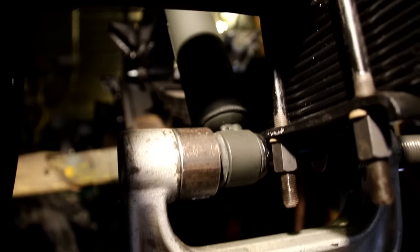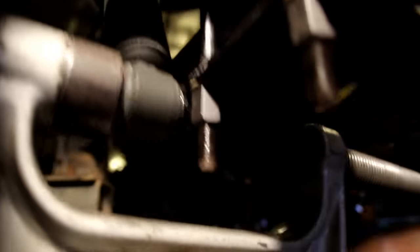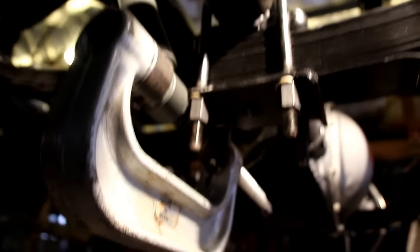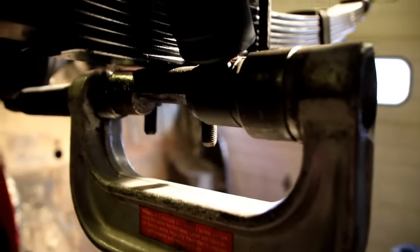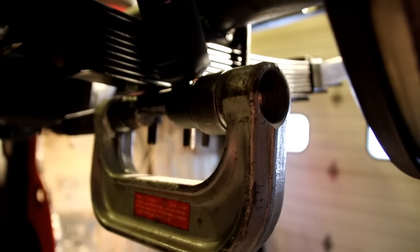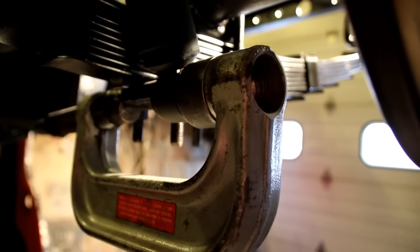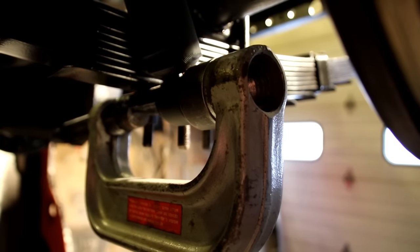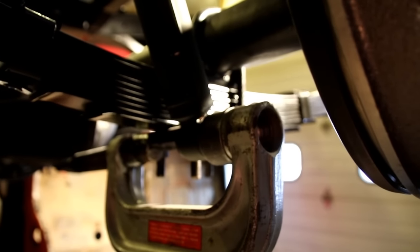On the bottom you can see we have the tool in the opposite direction. Our little homemade piece registers nicely — fits in the hole, doesn't slop around. We just tighten this up on the back of the actual shock mount and that works out perfect for compressing that washer. You put the tool up there, tighten it down a little bit, drop the cotter pin in, then release it. It's the fastest and easiest way I know. A lot of guys try to do it with pliers and it's just a pain — if you take a few minutes and make yourself a little tool like that it'll be a hell of a lot easier.